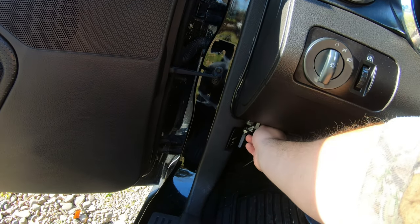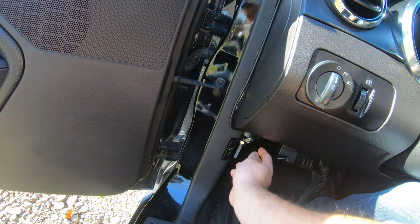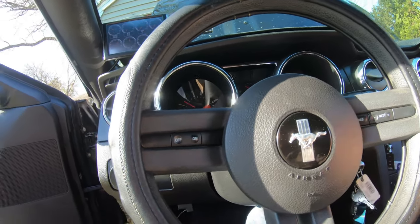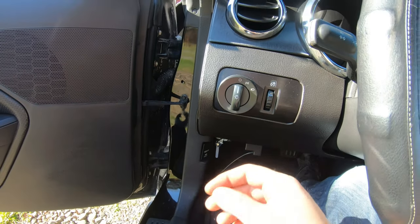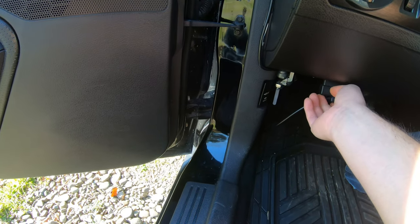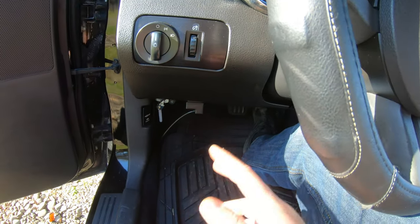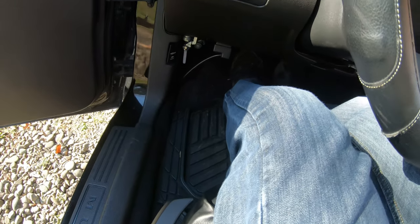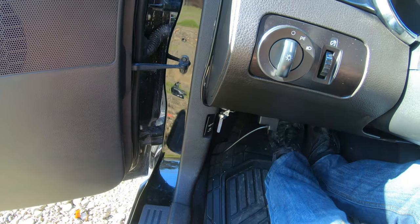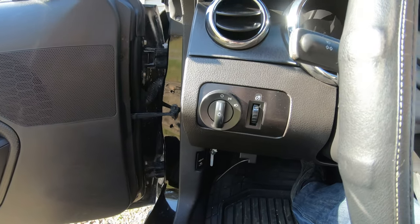When you are at idle and you quick-change it, it kills it — okay, so that's good to know. I think we can quick-change it if the RPMs are just a little bit up on the gas. So if we're in traffic, all we have to do is hold one foot on the brake and a little bit on the gas and that should be able to quickly change it. Yep, no problem. It's just because of the lope idle speed that we have set — that's why it kills it when we quick-change it.